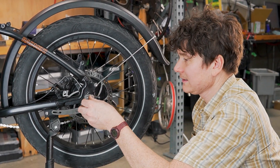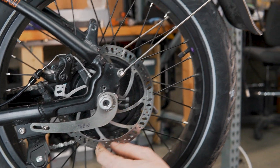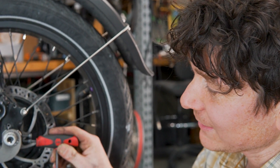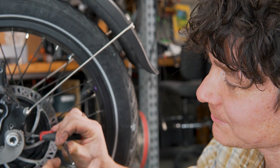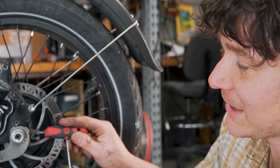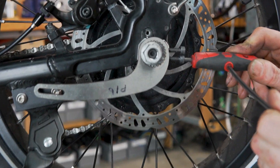Let's put the nut on. You'll see this doesn't leave a whole lot of threads on the nut, so we wouldn't want to tighten it to that 80 newton meter recommendation — but we have so much grip from the torque arm itself holding the axle snug. We'll have a separate installation video for these torque arms, but one important detail is that the preloading bolts that pinch the axle are tightened to about 12 newton meters. That ensures the clamping force on the axle is preloaded to an absolute maximum. We recommend using a torque wrench if you have one, since 12 newton meters is quite a lot for a little M5 screw — which is why it's important to use the supplied graded bolts that come with the kit.